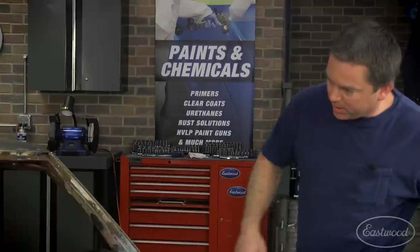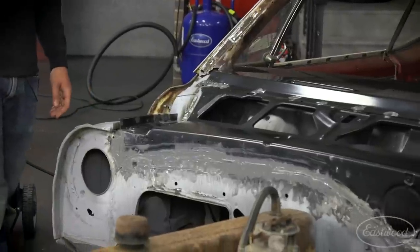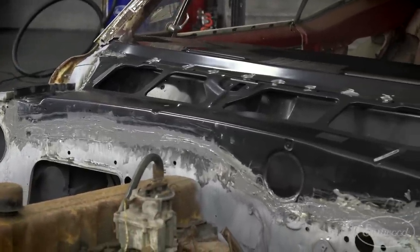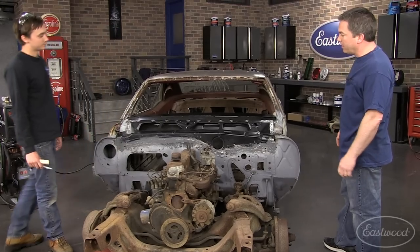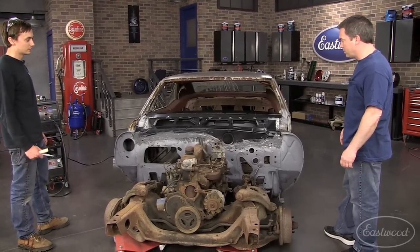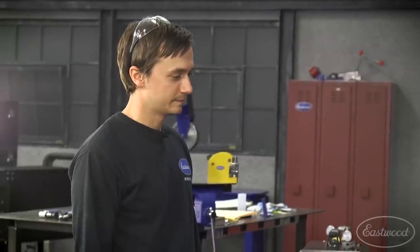So what's going on here? This is our body panel adhesive — it's a little stronger than seam sealer. I saw Mark using it on the Corvair. Right now it's curing, but once it's cured I'll be able to sand it, level it, and kind of hide that factory GM seam. Plus it's going to give it some structure, so with this being an older car I think it'll really stiffen it up.